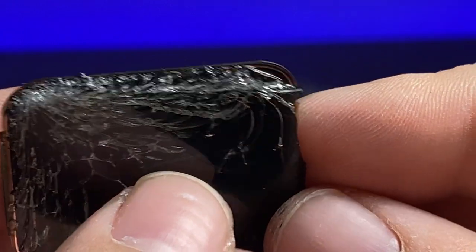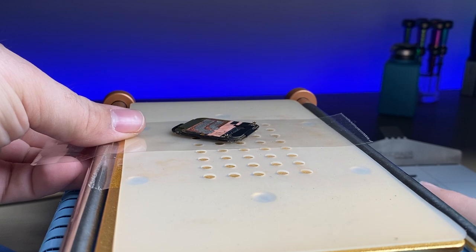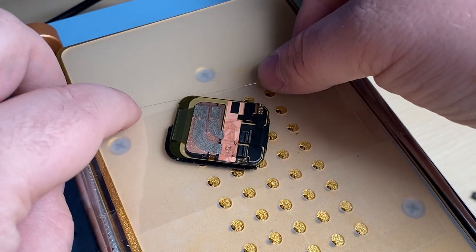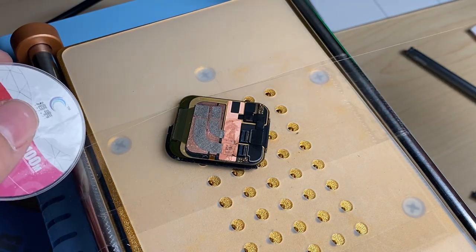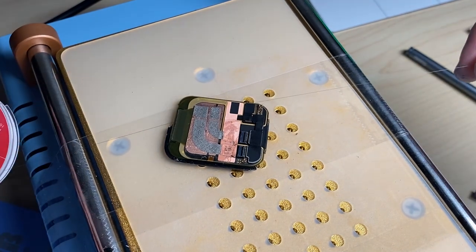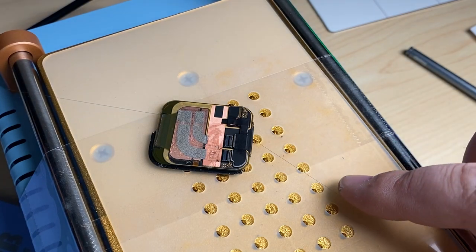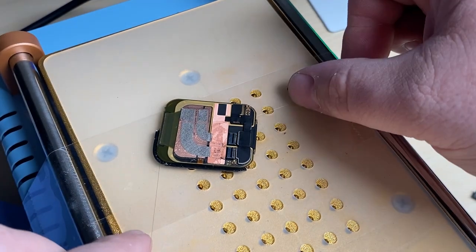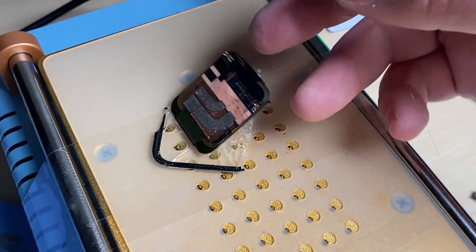This corner looks like a good corner to start cutting on. I'll put it back on the heat plate, get it nice and secure. I'm going to take my cutting wire and carefully rest it up against the display and start to slice using long strokes. I'll speed this up because this is quite a tedious process — that wire can easily slip into the layers of the digitizer and make the job harder. Using the correct amount of tension on both the pulling and receiving hand, I'm able to slice in between and remove that display.